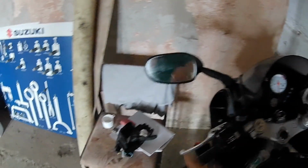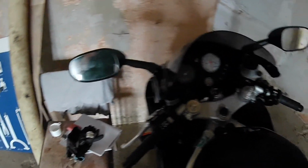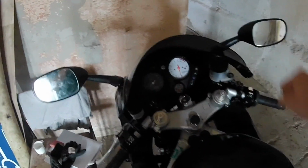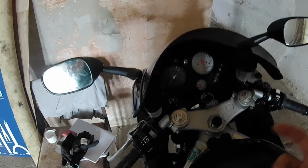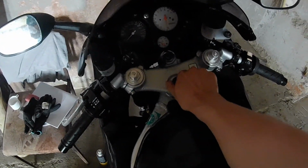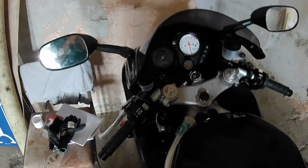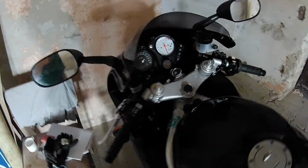First, this bike crashed a little bit on its left side last time, so maybe the handlebars are turned in on the left side, so you have to compensate to the right side. That's one thing. The solution for it is easy. Loosen this nut, loosen those nuts here, just spin it a little bit to the left, to the right, I'm sorry, and it's repaired. But the other thing that I noticed is that this wheel has a ton of play in it.